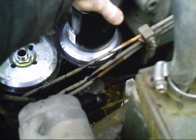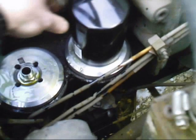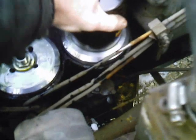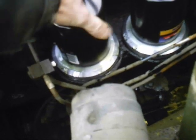No wrench — never use a wrench to put your filter on. Once it touches down, give it a quarter to a third of a turn, give or take. I don't need to grease or lube that up because I did the base. Same thing — put them on there, spin them until they touch down, and then give them a quarter to a third of a turn.